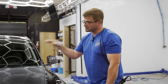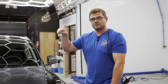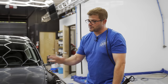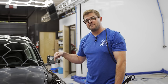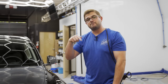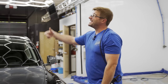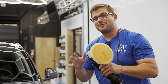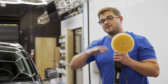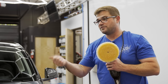The hood is finished — that took me roughly five minutes. I'm leaving product on the car and will continue to do this through the entire process. That's the whole point of Uno Protect: let it set up, then come through with Beadmaker for the wipe-off, and it's going to be smooth and look amazing. For more correction out of this combo, you would jump up to the blue coarse wool or hybrid wool from Rupes, which gives more correction but may introduce more micro-marring. I love using wool because it keeps the heat down. To save time, I'll knock out all the big areas with the LHR-15 Mark III first, then use the LHR-75 Mini for smaller areas.